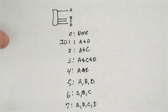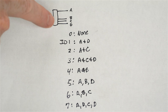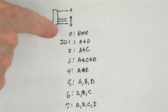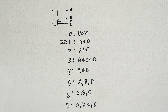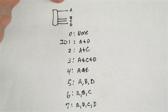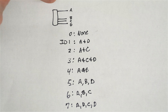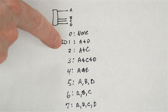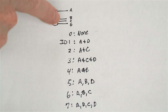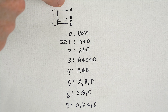Doing all those checks enabled me to create this rough hand-drawn diagram showing the connectors. I named them A, B, C, and D from top to bottom. When the SCSI ID is set to zero, A is not connected to B, C, or D — none are connected to each other. For ID 1, A and D — the topmost and bottommost pins — are connected together.